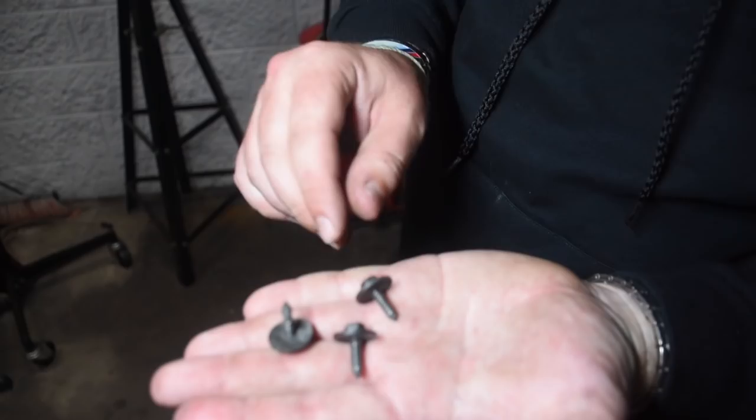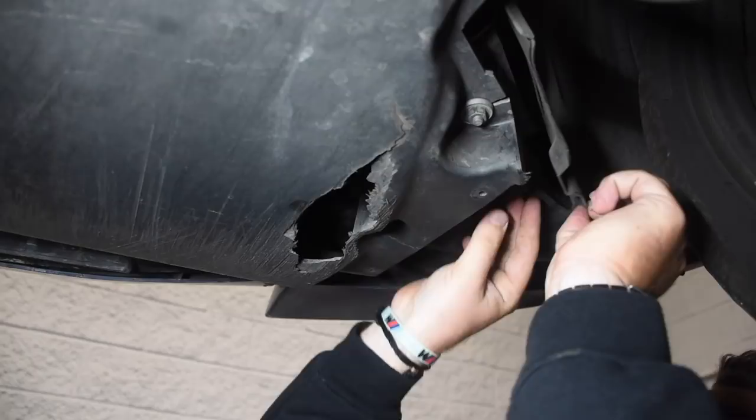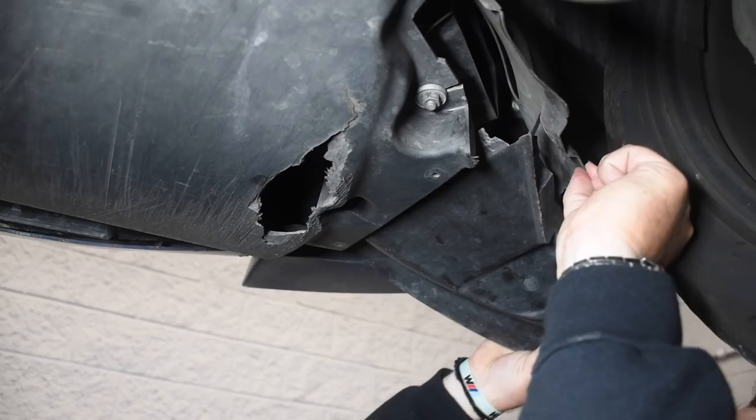After just a few turns you can get these bolts by hand. So this is what they look like — only three. Remove this part; this part is flexible so you just pull that back, push it in towards the engine, and then it should just come out just like this. I set it down off to the side. The six millimeter Allen I was talking about removes the drain bolt for the oil filter right here.